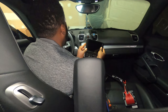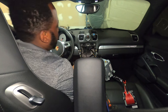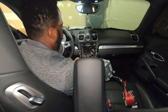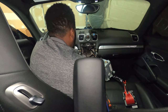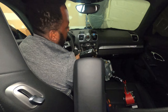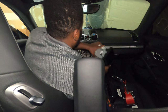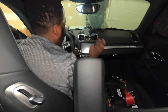Because I don't want to mix them up, I'll place one on this end and one here so I know which goes left and which goes right. Now you're exposed to the four T25 screws — go ahead and remove those. Once the four are removed, you can slide the radio out and place it to the side. Next, we want to remove the AC control, then put the radio back because the radio will be in the way after we remove the AC control.